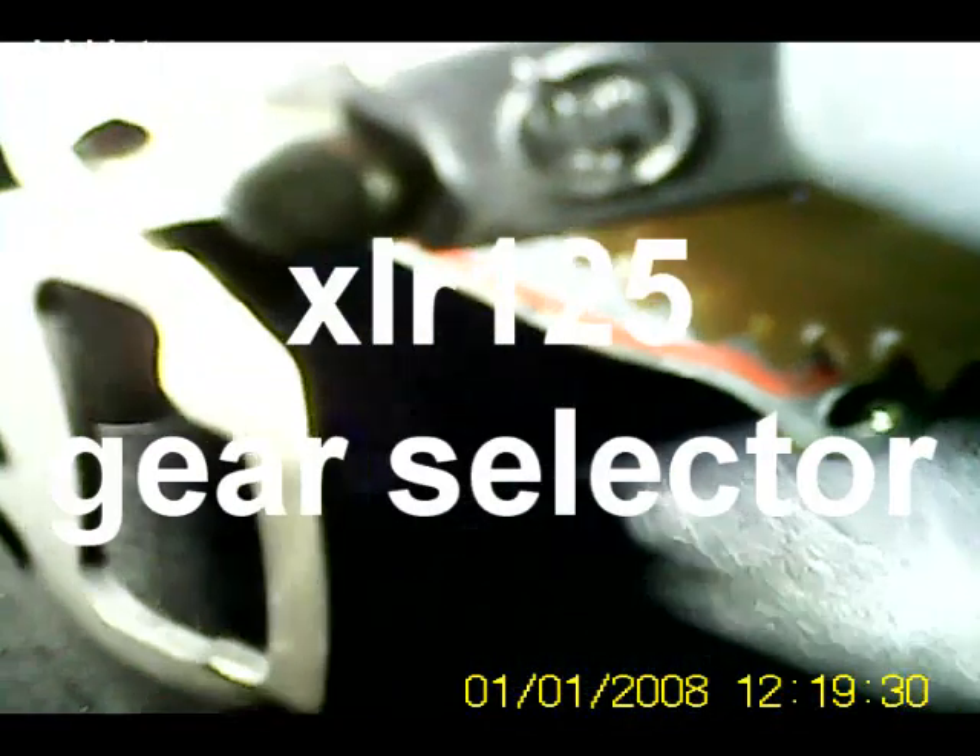Right, so we're looking at the one I've just took off, and you can see — sorry it's a little shitty camera — there's a wear mark right there. That's where the cog touches on. If you get the new one — well it's not new, it's an old one off another 125 of some kind — there's no wear mark in that place. I'll draw a diagram to explain where that wear mark is if you can't tell from the video.